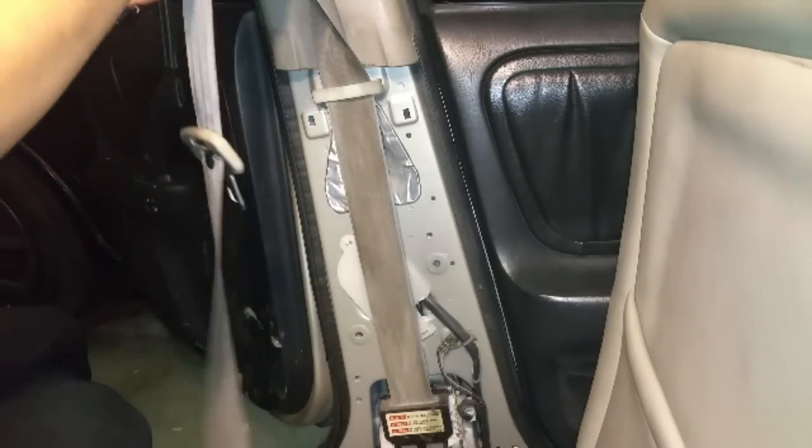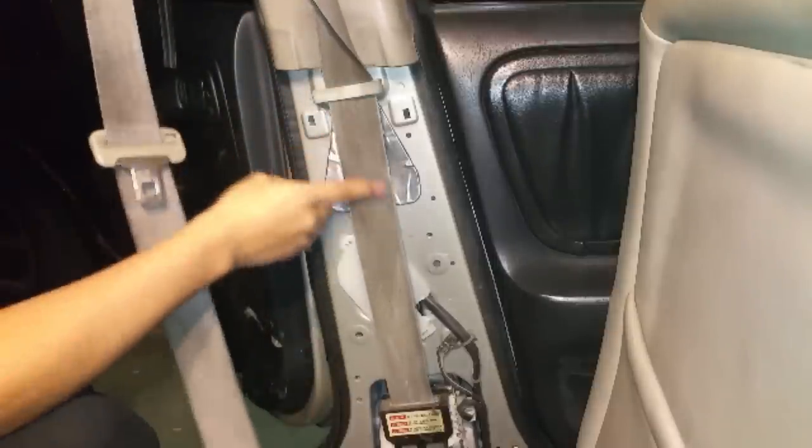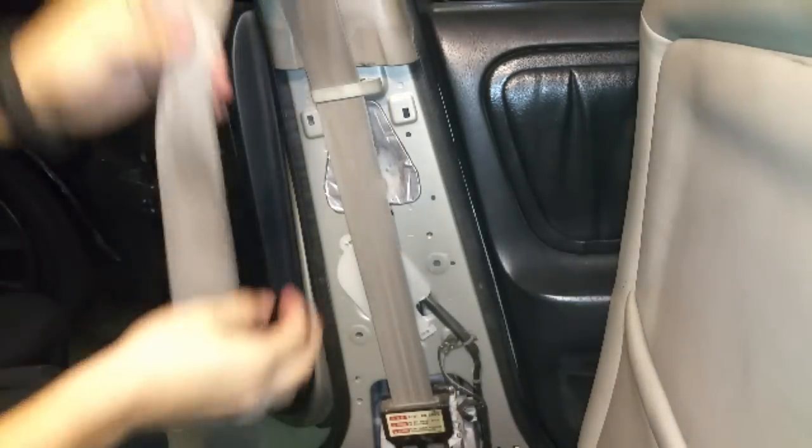Now that we have the seat belt unmounted from the bottom, we can start fixing the direction of the seat belt. You can tell it's not going straight, and it should be. What you're pretty much doing when the seat belt is tangled and not in its right orientation is: let's say it's twisted — as it goes up, you want to fold the seat belt before it reaches the top, floating it in the correct orientation, and pull really hard upward. This should squish it onto itself so it fits through the hole, and as you can see it's now facing the same way.